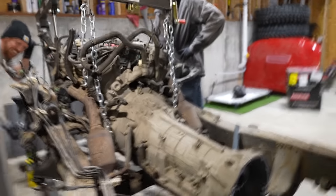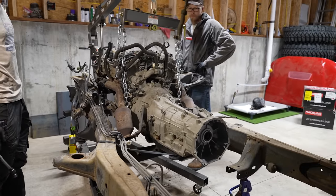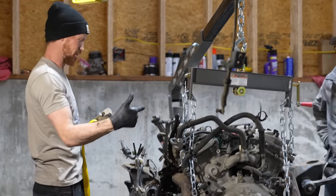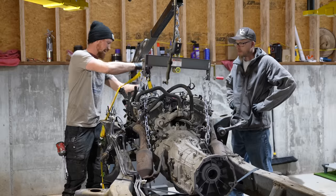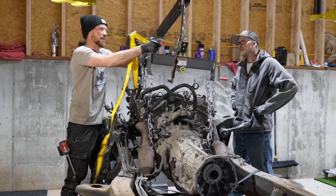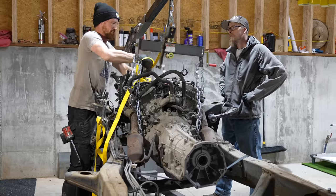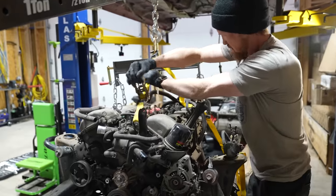She's rocking — it's just picking up the transmission; all the weight is up front. This is 100% not the right way to do this. Where I have the motor supported at the back, there's way too much weight in the front and not enough in the back. I'm going to put a tie-down strap around a support on the front and hook the other end to the cherry picker. By tensioning and ratcheting these two points together, it should counterbalance and pull the front of the motor up.